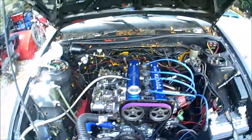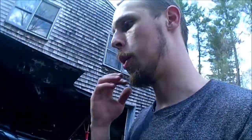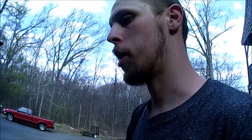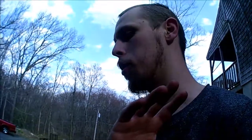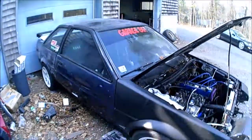So that's where we are now - it's running really hot, and that's why I'm letting it cool down a little bit. I'm right at about 140 now - it got up to 200 while letting it idle. I want to let it drop a little bit because I'm going to take my thermostat all the way out just to make sure my water pump's actually doing something. If I don't, I've got about three other ones inside. We're getting there - it's out, it's outside, and that is better.